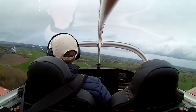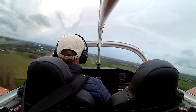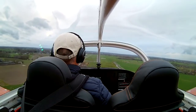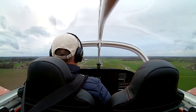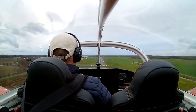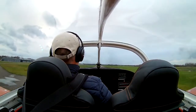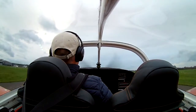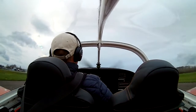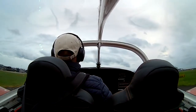During test flights I use these speeds: on downwind I try to get it to 85 knots, on base 75, and turning to final I want 65 knots with about 30 degrees of flaps — I don't use full flaps yet, not with this wind, and I keep the speed maybe a little high, but for now that's good enough. Aiming for the numbers. I'm not sure — I think I still feel a little main wheel shimmy; I'll try to get an external camera on it.